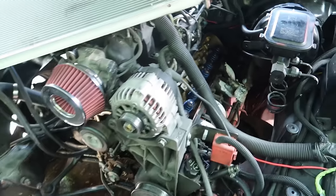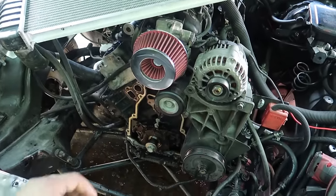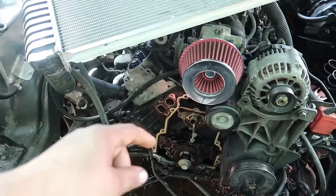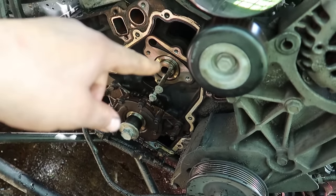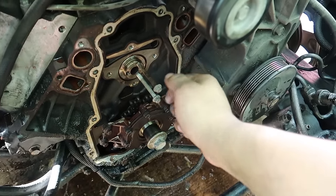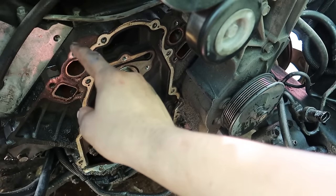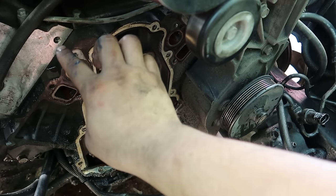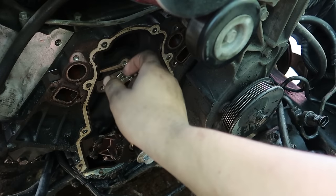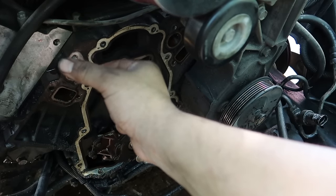All the valve springs are swapped out - that's the most tedious part, takes the longest. Now on to actually swapping the cam, which is probably the easiest part of the job. I like to use water pump bolts because they're super long and the same thread - you can use them to spin the cam, which pushes your lifters up into the plastic trays that sit in the block. The trays keep the lifter from rotating, and when you spin the cam with no push rod it'll push the entire lifter up into the tray and hold it in place.